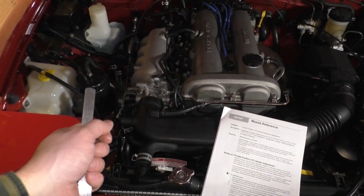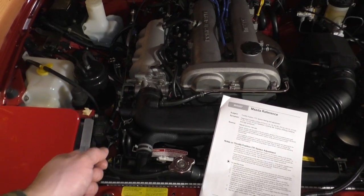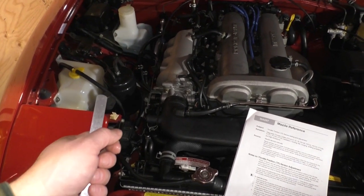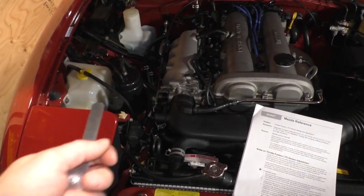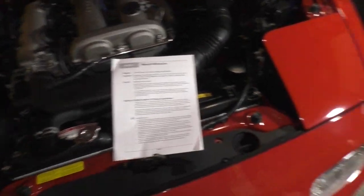It should snugly be able to be slid back and forth without bending. You should be able to push it in and pull it just ever so slightly. It needs to be snug in the bore, but you don't want it cramped down on it. You also don't want it to be, you know, loose as a goose. So